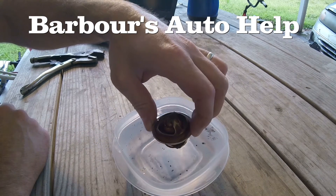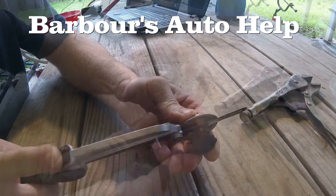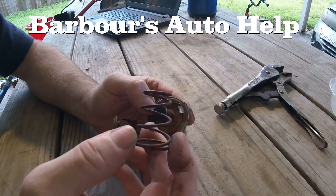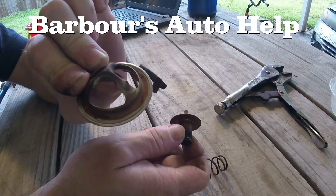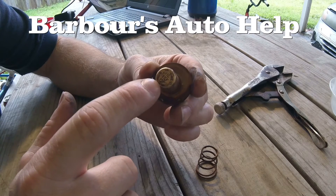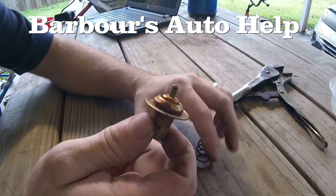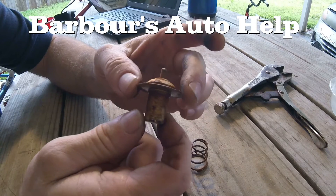Now for a little bit of fun, I get to take it apart — I'm just going to saw it off right here. So we got it broke through. There's our spring, and there's our valve and our heat motor on the other side of the housing. Something to note: usually on the bottom of your heat motor will be the rating of the thermostat, and this one's 195 — that's the temperature at which this starts to overcome the spring force and opens the valve. It starts then, and about 10 degrees later it's going to be fully open.